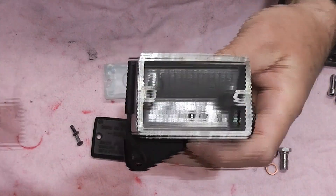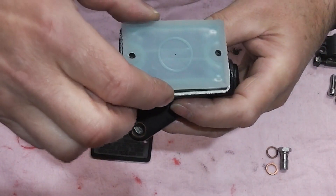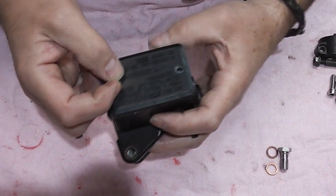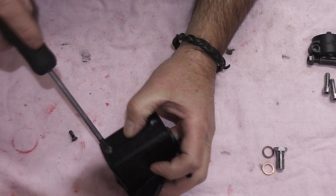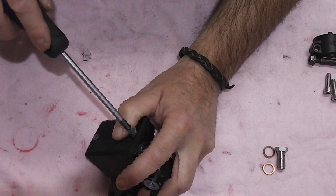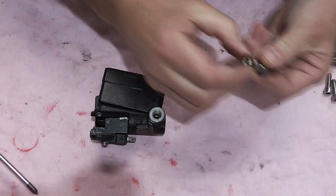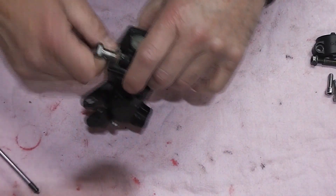Next we've got the rubber diaphragm that goes on top, then a plastic piece that goes in the top of the rubber diaphragm to hold it in place and stop it deforming, then you've got the lid — two screws, job done. The screws aren't very pretty so I'll probably end up putting stainless replacements in simply because it looks pretty. Put the lid on so muck doesn't get in there. There's our stainless banjo bolt — put that in there to stop muck getting in. And that's basically it folks — that's your master cylinder.